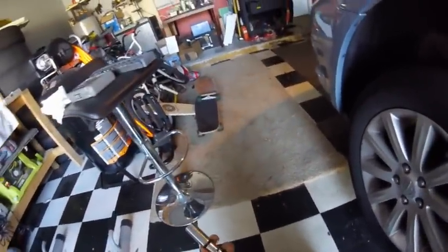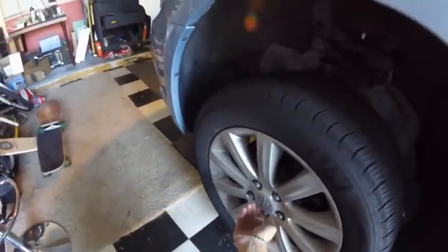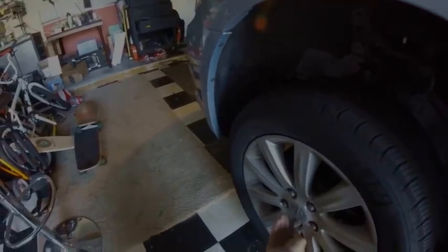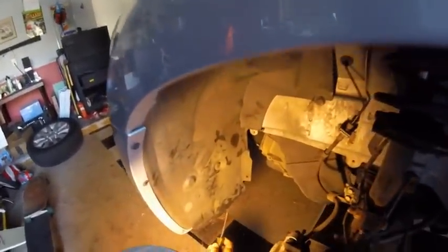Like I said, on this 2013 Chrysler 200, the lug nuts are a 19mm. I'll just use a deep socket. They're already loose, so I can just spin them off. So y'all can see what I'm doing here. You gotta remove this tab, this tab, this tab, this tab, and this tab. Oh look, that tab's coming out. I didn't push that one in all the way, from when I replaced the battery yesterday.